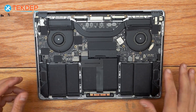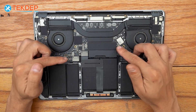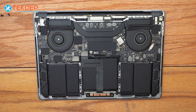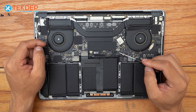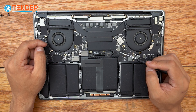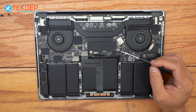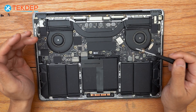Since we're going to be replacing the LCD today, most of the work is going to be in the top section. However, under this little cover here, we do have to disconnect the battery. I'm going to show you guys a little trick so you don't have to mess with this battery management unit flex cable. This cable is responsible for telling the battery what percentage it's at, when it should charge, and if it should charge. If this cable is not plugged back in correctly, the unit will probably turn off when you unplug it or have some weird battery things.